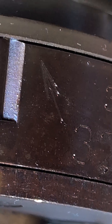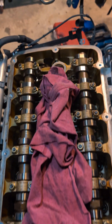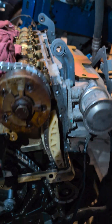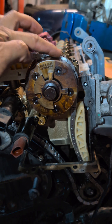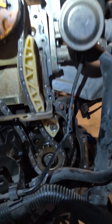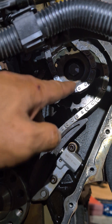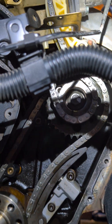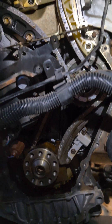On the exhaust cam you can see there's the arrow here and that lines up to those notches there. Time to test the timing — remove that locking plate. The marked link there lines up to its spot: three chain links, middle one goes to that notch. Then release the tension and test the timing.